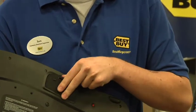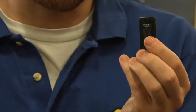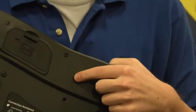If replacing the batteries does not solve your problem, you can also try to reconnect your wireless keyboard to the wireless receiver plugged into your computer. The way you would do that is push a little red button on the back of the receiver. This would cause the receiver to start to flash. Once that happens, find the red button on the back of your keyboard and push that as well. This should reconnect your wireless keyboard.